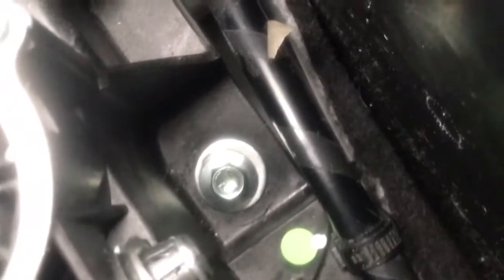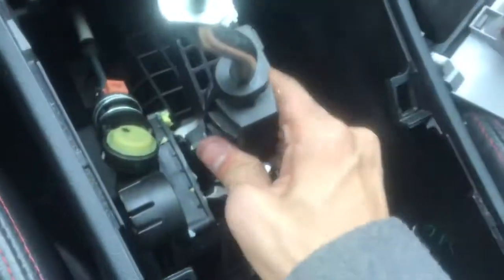And there you go. Don't tighten them too much, because if I can zoom in here, you'll see it started to make a small crack or indentation, like the washer is not fully in the middle. So it doesn't need to be tight, not tight at all actually, to have it perfectly in there. So don't over tighten it, because you don't want to break the plastic shifter box or whatever. And yeah, now let's put everything back.